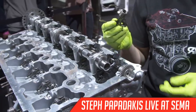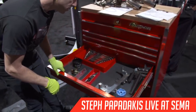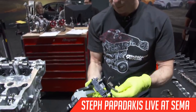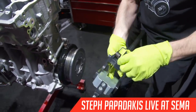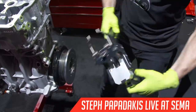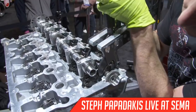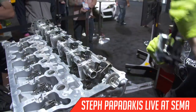It takes a special tool, an SST or special service tool, and I have one in my drawer, which is this right here. I'll show you how this works. You've got to load up the spring. You have to open this up a bunch. That gets loaded up there. Then these little grooves push on the spring. It compresses it. There's a little lock. And then we slide it underneath the intermediate rockers, and then I let the tension go, remove the tool, and then it's in.